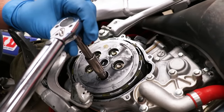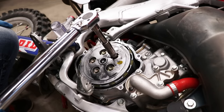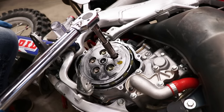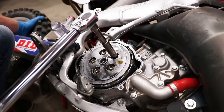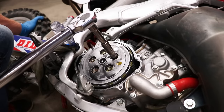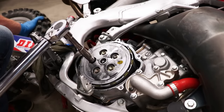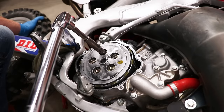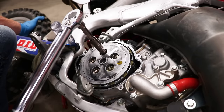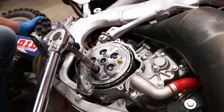Clicked into gear and I should be able to torque these bolts easily now. As you're torquing, it's going to move the rear wheel a little bit, so you may have to hold the rear wheel in place as you torque down these bolts. You want to torque them in an even pattern — like a star pattern, which is what I'm using.